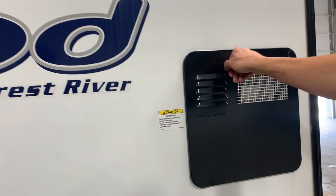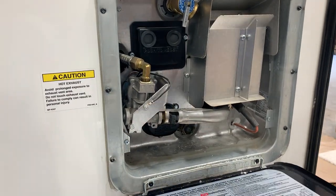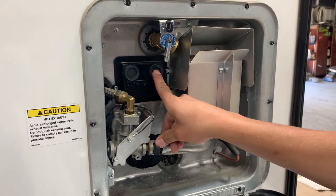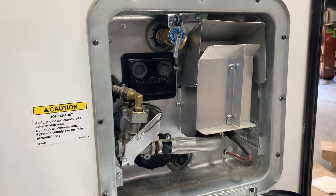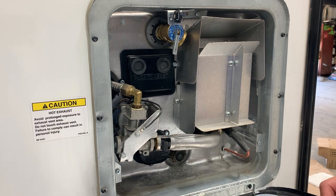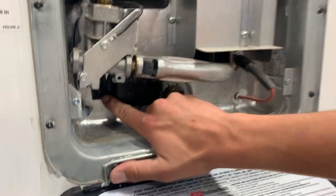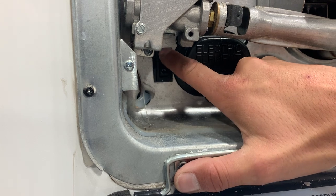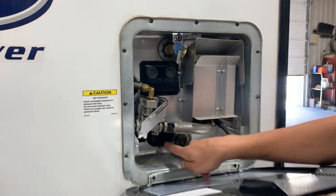We also have your hot water service port. Notice the sticker — it does tell you this can get hot whenever it is running. You've got your reset button right here, and your pressure relief valve. Whenever you first get to your site, just hit that relief valve and there should be a shot of water coming out, letting you know the tank's full. We currently have the tank drained ready for customer pickup, but as soon as you turn on your water pump it will start filling. You've got your inch-and-an-eighth drain bolt right down at the bottom and a little power switch — that's if you're wanting to fire it up on electric. With it off, when you hit the button inside it fires on gas; if you turn this switch on, it fires on electric, which is just a small element inside.